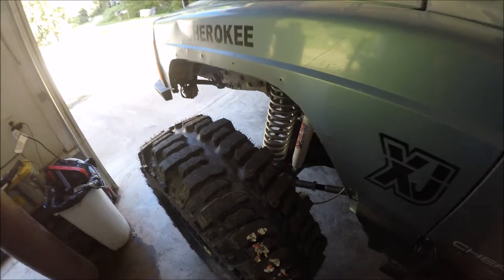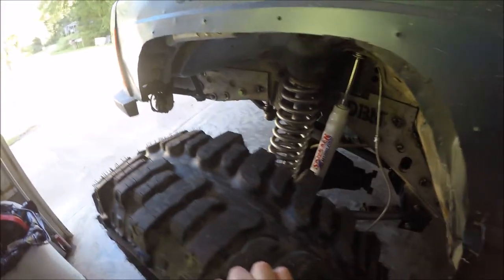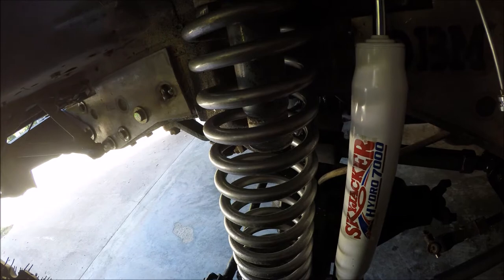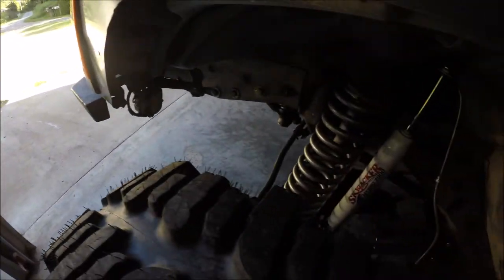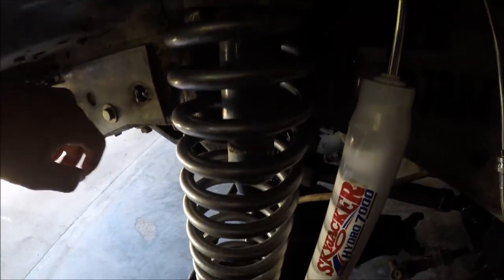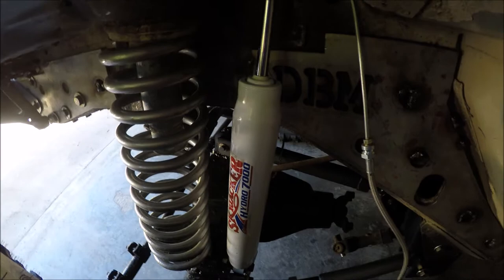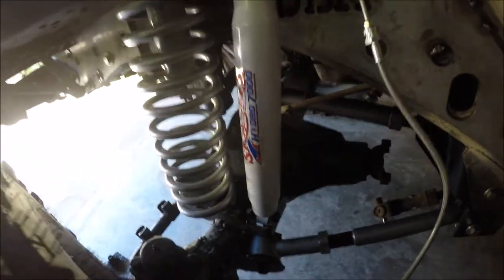As you can see, I got the Jeep turned around and the front axle is in. I didn't want to bore you guys to death showing step by step how to install the axle. There are a few things I did do — I got a new set of coil springs. There's nothing wrong with the old ones, but with this bumper and winch it definitely had the front end squatted down a little bit, so I bought these — they've got a little bit higher spring rating and it does a lot better. These are the Rubicon Express five-and-a-half-inch springs. I also went ahead and got some longer shocks — the other ones just really weren't long enough and I wanted the axle to flex a little better. So I picked up the Skyjacker Hydro 7000 series and we'll see how those do.